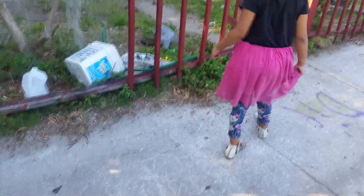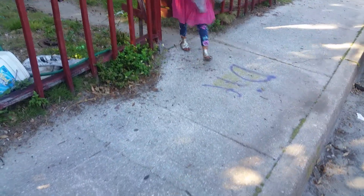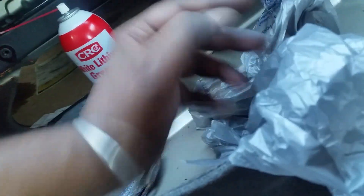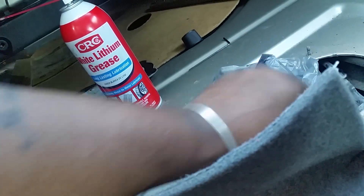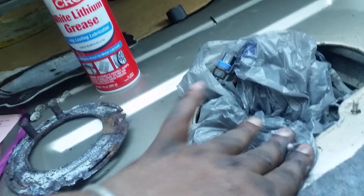Set it on the ground — that's the first part of the equation. While you're at it, inspect the tank; it doesn't look too bad inside. Now get a plastic bag and place it right over the opening. That stops anything from falling inside the tank. Hook the two corners so it doesn't fall away into the tank.